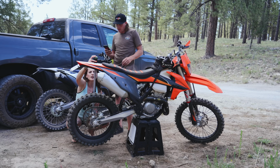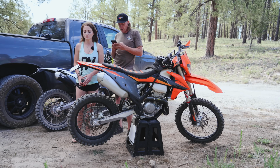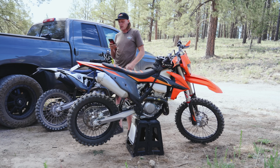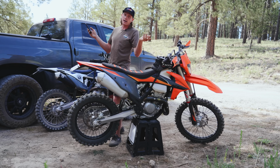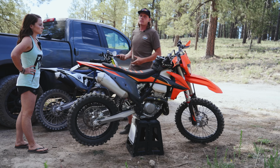is 25.25. So we got 641.35. We're going to subtract that by the 606.425, and we have a static sag of 34.925. Might as well round up to 35. So that's pretty close to the 37mm spec.